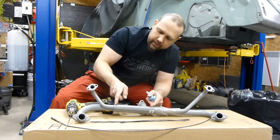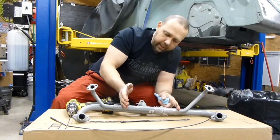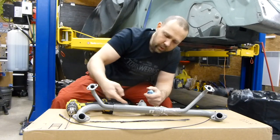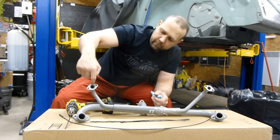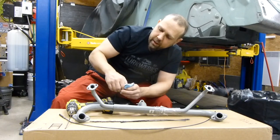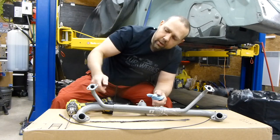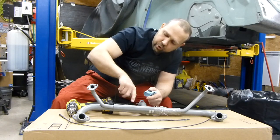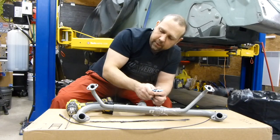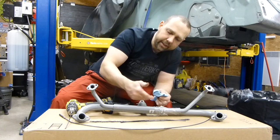Once you've gotten that done, step up to the larger one — now really trying to ream out the area here, which is the worst part. You want the 43-inch long one to go in one end, ream out, and come back out. As you're doing this, as you're pecking at it and trying to break through, take out your cable and run some compressed air to try and blow that broken-down carbon out. Some will fall out with the movement of the cable. Try to clear that out as you go, emptying that area and leaving more room to break up more carbon.